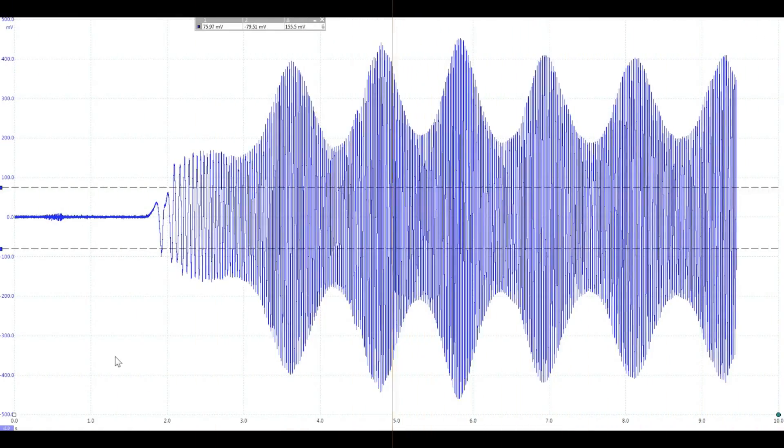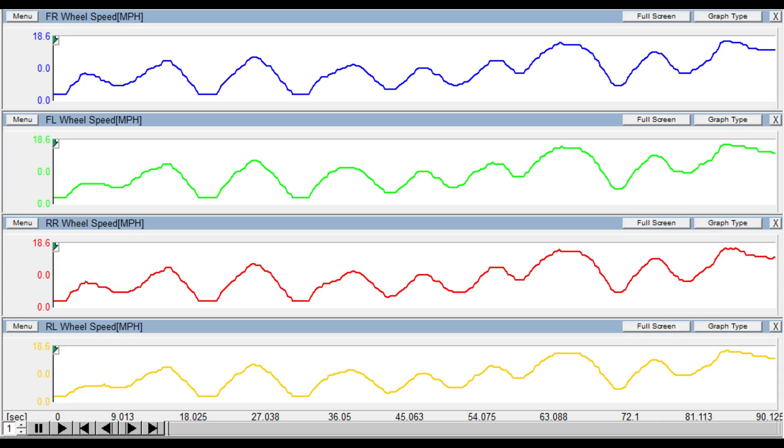Spin the wheel the same speed I was last time — you can see on the PicoScope that the amplitude is substantially better. All that's left is to take this one for a drive and see if it's fixed. If you look at the graph there are no more dropouts in the wheel speed sensors. If you guys need a better explanation of how the amplitude affects the wheel speed sensors, I'm going to post a link to Mike Becker's YouTube page — he has a video on how the amplitude affects how the ABS computer interprets the wheel speed sensor. I'm going to call this one fixed, so please like and subscribe if this helped at all.